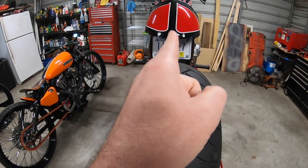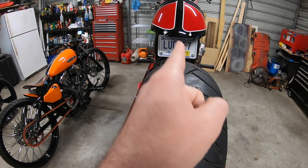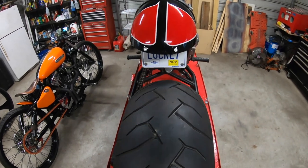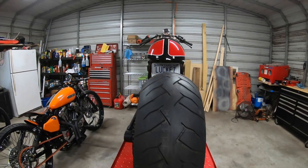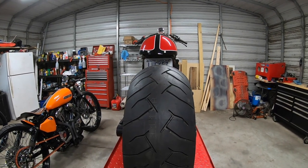Here it is, back mounted on the bike, and it is incredibly better. As far as the profile, it's way more round — I should be able to take corners a lot easier now, and the chain is almost dead straight on. We've got a little bit more clearance out of the tire here — it's still kind of close, but definitely way more than we had. We don't have to worry about the tire being off center. The thing is perfectly tracking straight now.